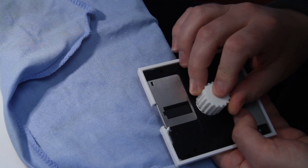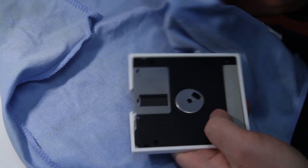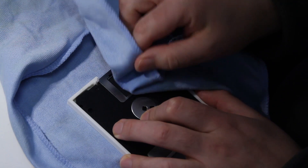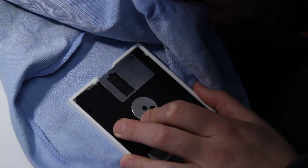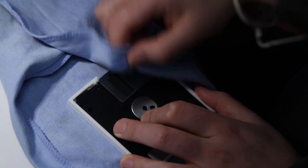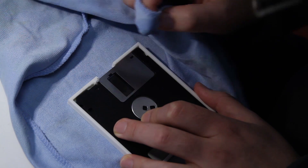Just so that you feel the friction with the turning knob. The advantage of cleaning the floppy while it's still in its case is that it's less prone to damage to the disk surface. You only have to remove the disk donut from the case if the donut comes loose from the disk metal hub. There's still a bit of grime stuck at this place, so I give it some extra cleaning here.